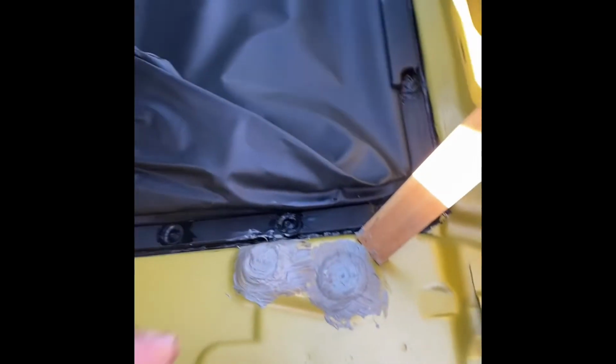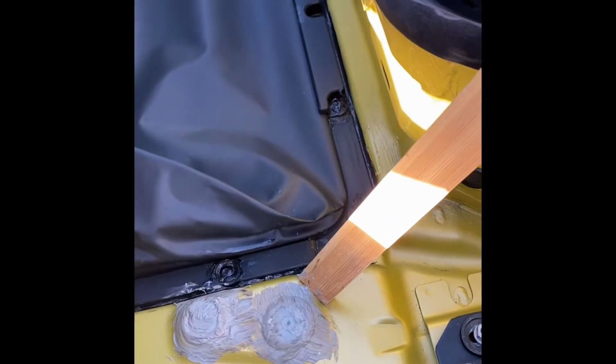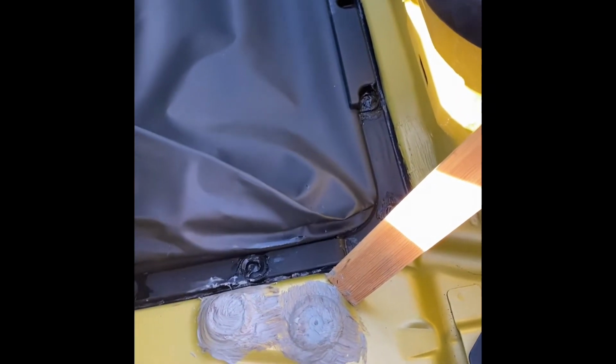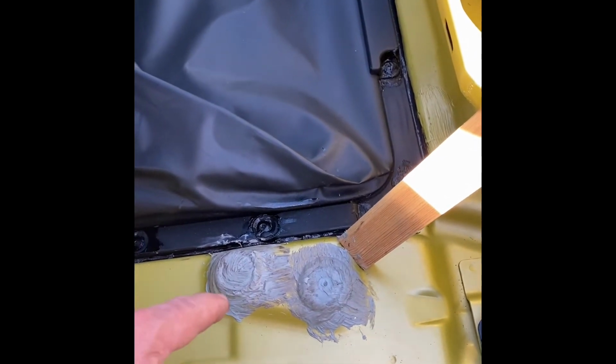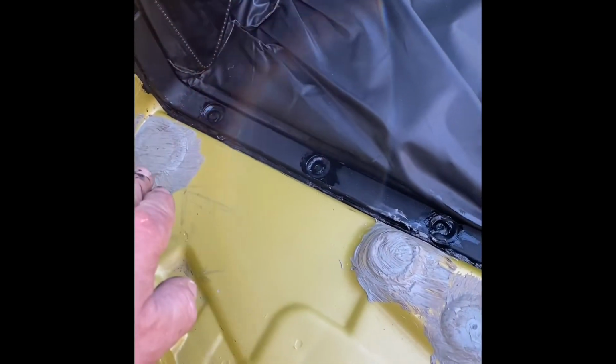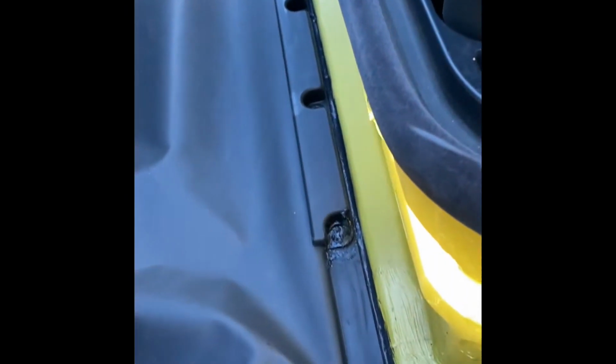Hello, one other thing is we found that these grommets can turn a little bit. They're not exactly tight, so what I've done to ensure there's no further leaks is put joint sealer around them to make sure that they're sealed. We've got 3 of them on each side, 1 there and 2 there. So now the whole thing, there's no more bows up along the top there. That's all bolted in place and sealed, and I've sealed all around the whole plastic thing, whatever they call it.